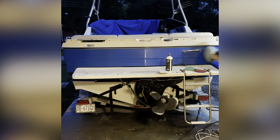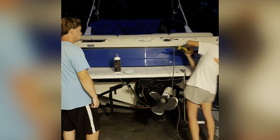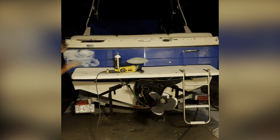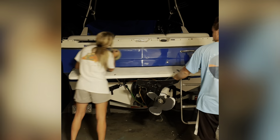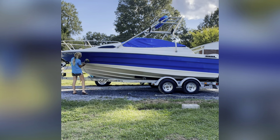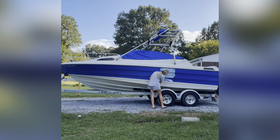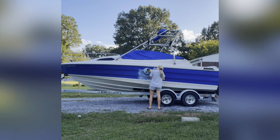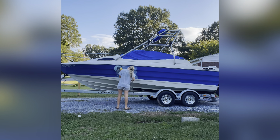Now that we're done wet sanding back here, we are going to start compounding with Stark Level R. You can buy a gallon for $169 or the 32-ounce for $59 on their website. We are using a DeWalt Rotary with a 3M real wool pad — do not cheap out on the pad. We start at 1,000 RPMs; once you work all the compound in, turn it up to 1,800 RPMs until the clarity has returned. There shouldn't be any residue left to wipe. Also make sure to work in two by two sections. When you wet sand properly, Level R will go a long way — you do not want to use too much, it will sling everywhere and clog your pad. Don't use too little either. I dotted it around in sections and then spread it out.